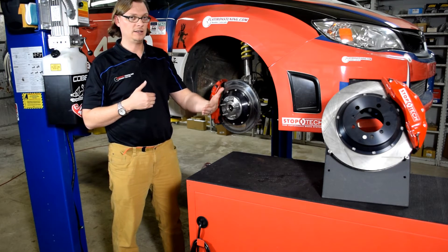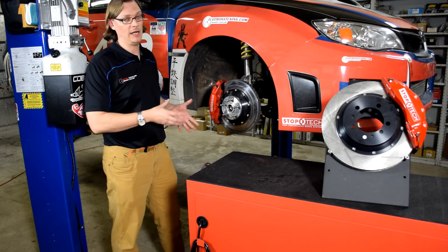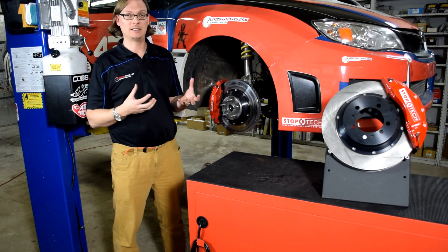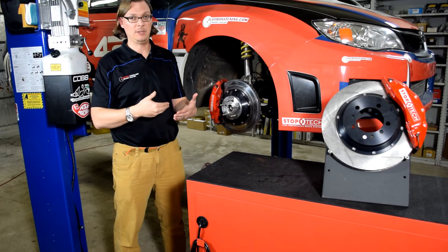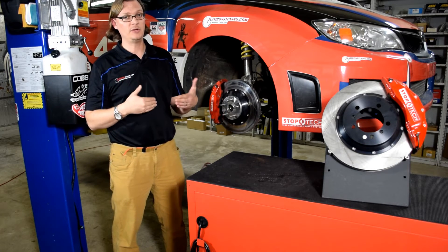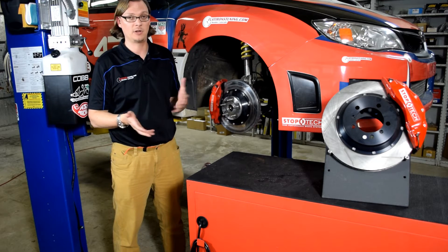When talking about achieving a difference in stopping distance itself, that largely has to do with the tires and the amount of grip available for the brakes to use. Brakes need traction and grip just like acceleration does, so your tires are the biggest limiting factor for stopping distance. Any car that can get into ABS can pretty much achieve that minimum stopping distance one time. If you're trying to make that shorter, there's nothing you can do to the braking system until you put on a tire with more grip — a wider tire or a stickier compound.